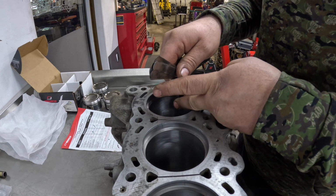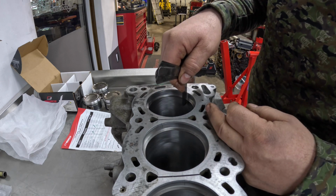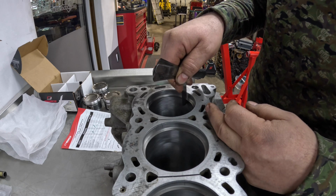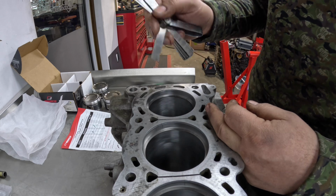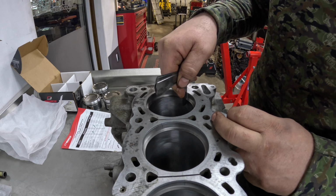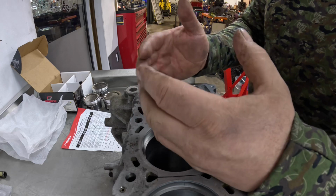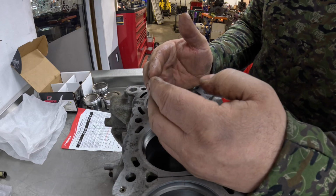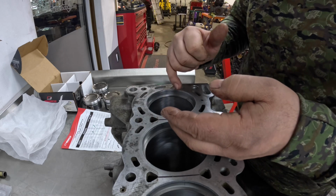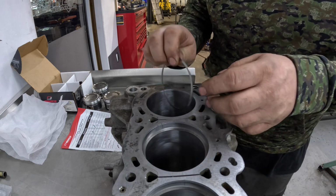Okay, so what I can feel now is exactly what I thought. We're getting the feeler gauge halfway down the ring there. The actual part that's nearest the bore is tight. So it's 19 thou on the inner side of the bore, but 18 thou on the outer side of the bore. And that's basically because of where we've machined the ring. As the gap has opened out, it's just moved it away from 90. So we can correct this dead easy, but this is why I try and do it in stages and don't just try and get it right first go.